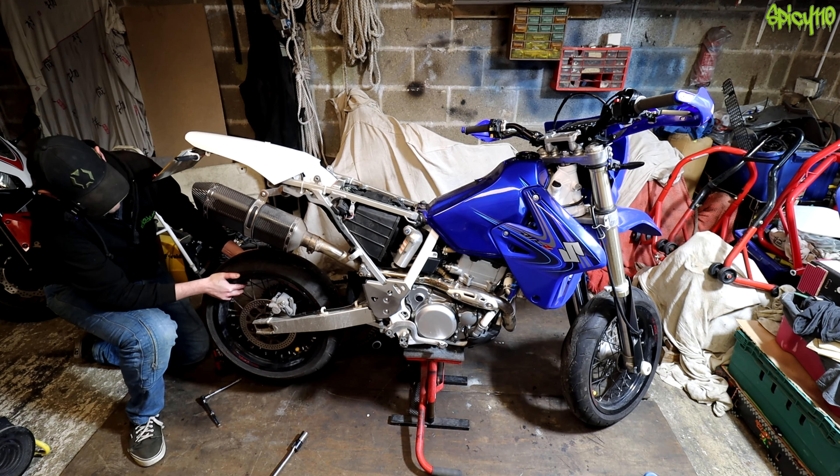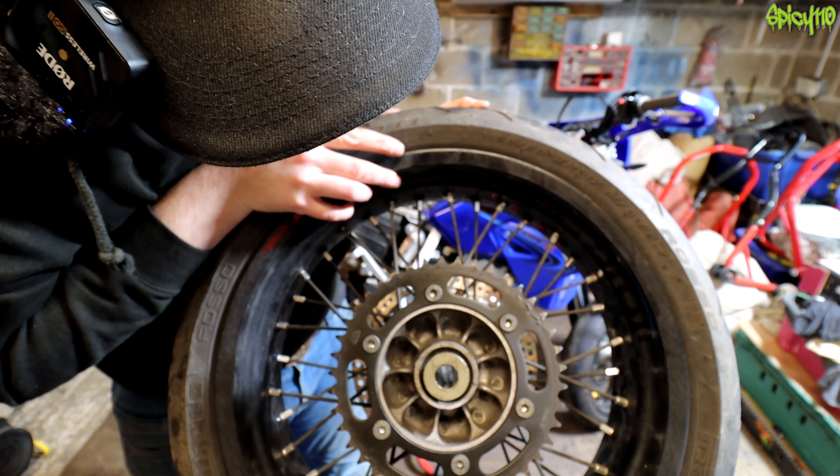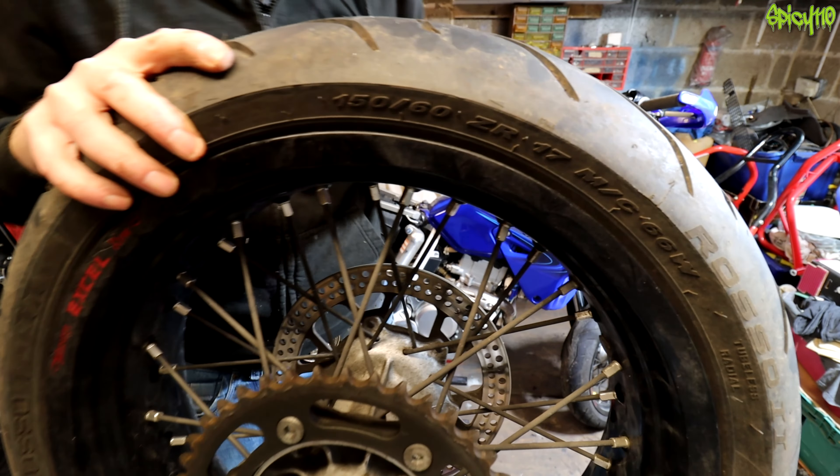I forgot the chain guide also has to come off. One chain guide removed — now we can get the chain off. Just looking at the sprockets — they're absolutely fine, don't need to do anything to those. The rear disc is looking fine; it's just over 4mm minimum, which is within spec, and I'm happy with these for now.